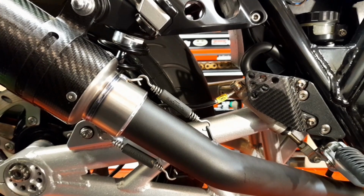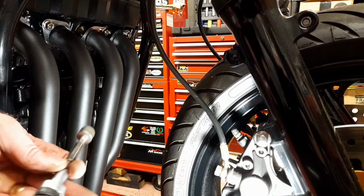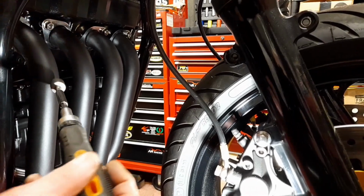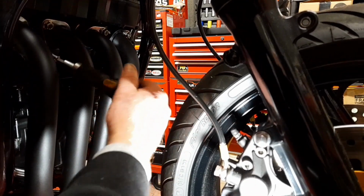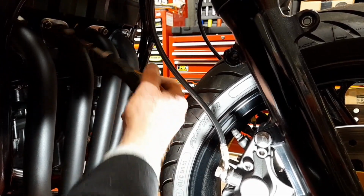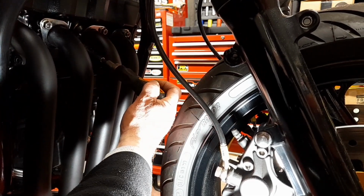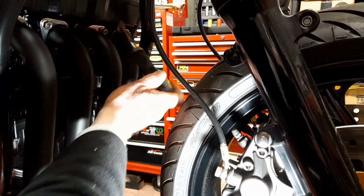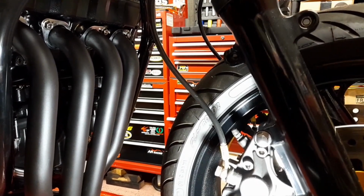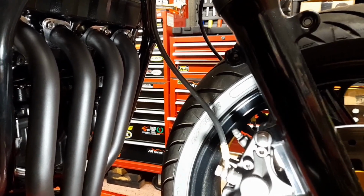Yeah, that's it. Now just tighten up the bolts at the header and we're done. Okay, so I just nip them up here first with this screwdriver and this attachment, keeping the exhaust pulled as far over this way as it can so that I've got a good bit of clearance. It also says in the manual that they are 34 Newton meters, but there's no way I'm tightening them anything like that. I'll do them about 20 and that'll do it.